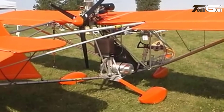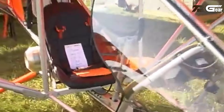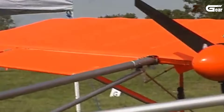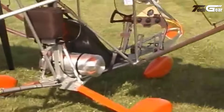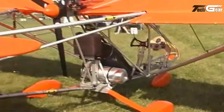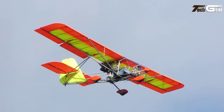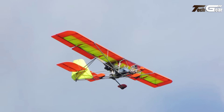The Aerolight 103 can be equipped with various engines ranging from 28 to 50 horsepower, such as the 28-horsepower Hirth F33 or the 50-horsepower Rotax 503, achieving a cruise speed of approximately 55 miles per hour, a stall speed of 26 miles per hour, and a climb rate of 1,000 feet per minute. The standard fuel capacity is 5 gallons, with optional upgrades to 7 or 10 gallons, providing flexibility for longer flights. Pilots appreciate its straightforward controls, featuring a center-mounted stick with a yoke, left-hand throttle, and electric flaps, making it an excellent choice for both novice and seasoned ultralight pilots.